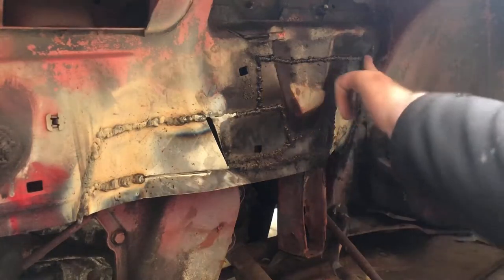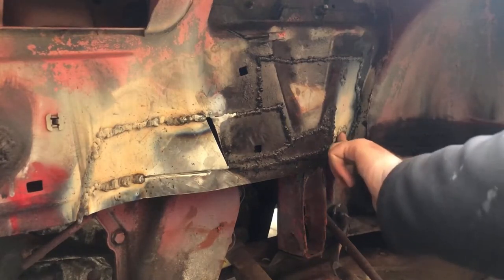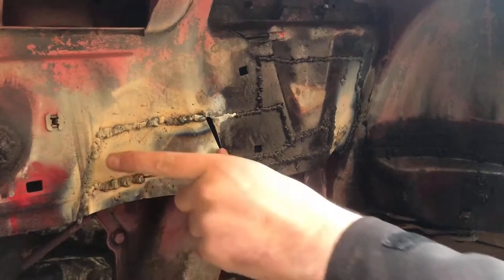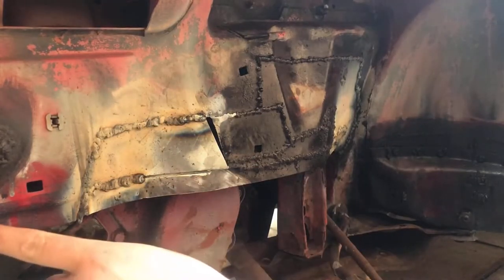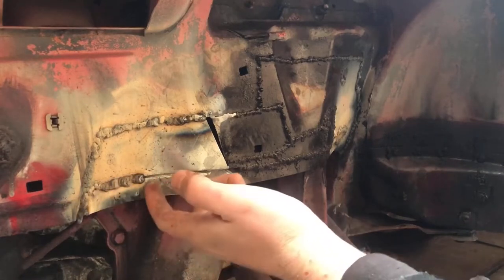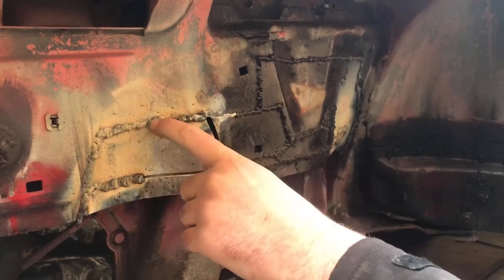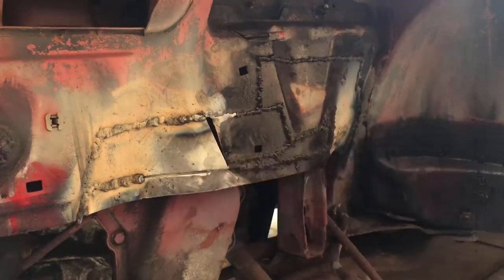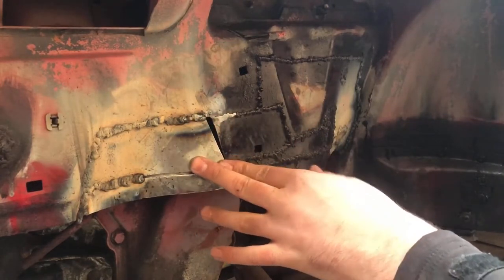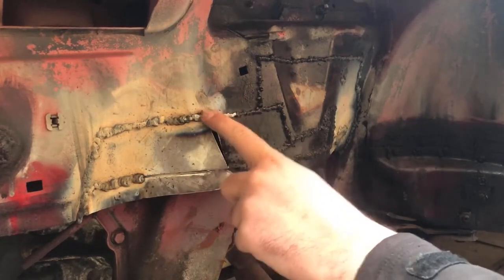Just a quick little update. I've rust remedied all this because we had a few days of bad weather. Just put a patch in there today. This bit is the third time I've done it — first I did this method, didn't like it, it weren't working. Next I measured 16cm which brought us to where that weld ends and that's where it's nice and flush, then it comes out. I welded this bit in up to 16cm then tried to put a new piece in, weld from there to there, and I didn't like that either. I don't think I'm going to be able to get it perfect but it's near enough, and hopefully with a coat of paint and a little bit of filler it should be fine.